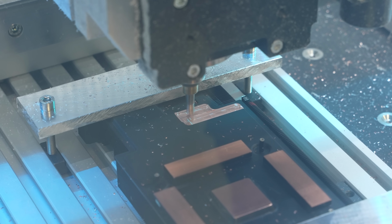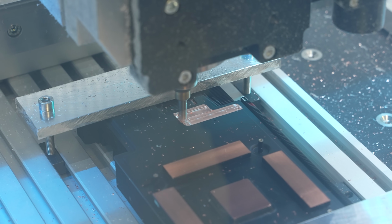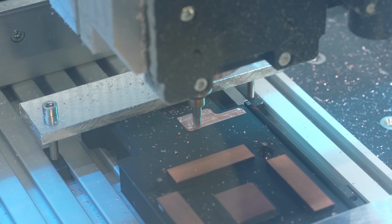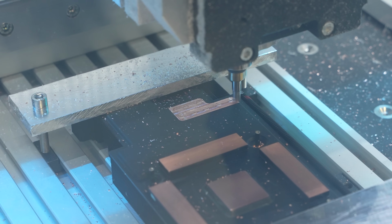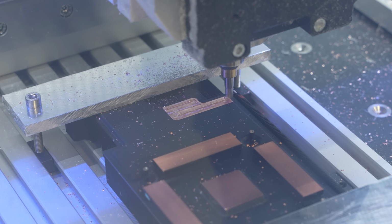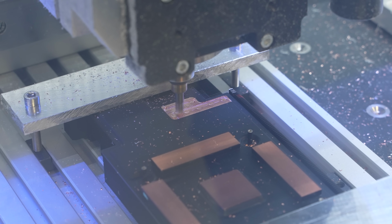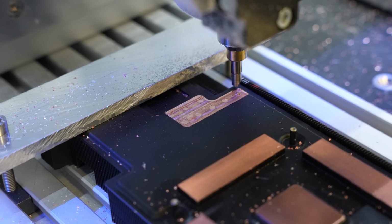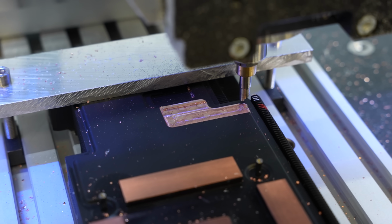Generally speaking, vapor chambers in our segment, the normal PC cooling segment, are typically made out of copper, and for visual purposes they are, at least in this case, black powder coated. In 0.2mm steps, we cut through the material step by step to see how deep we could go. After 1.0mm, we could see some kind of circles on the surface. We thought these must be the inner struts, the additional structure to give the vapor chamber more stability, because with a lower internal pressure, it would otherwise just collapse.